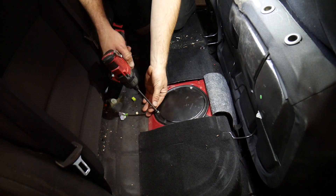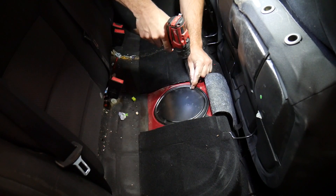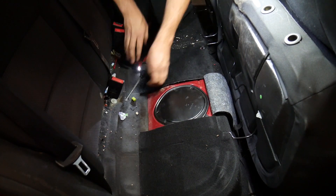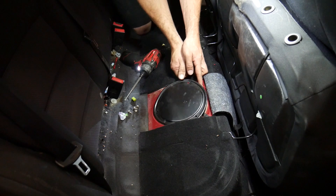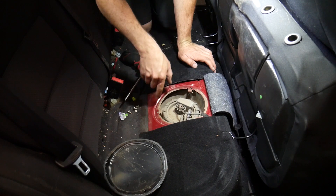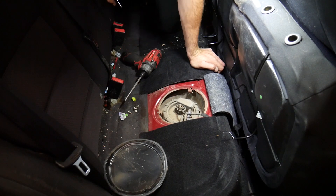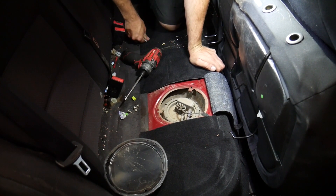There are three bolts or screws holding this access cover in place. I'm going to yank them out — the cover will pop up. It has a little rubber seal underneath it. Now we can gain access to this pump. We want to clean the dirt and debris around it if there's a lot. This one has a little bit. I'm going to grab the vacuum — you don't want to take an air hose in here and blow dust all over the customer's vehicle.